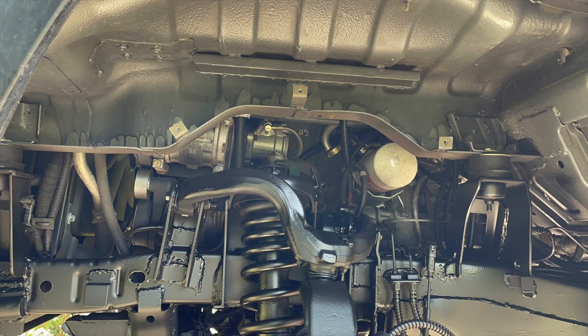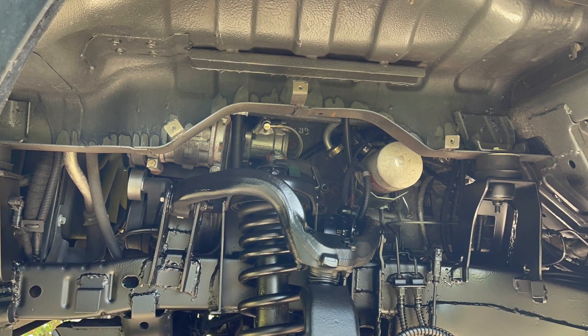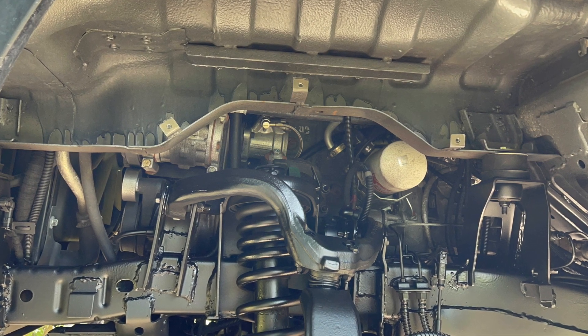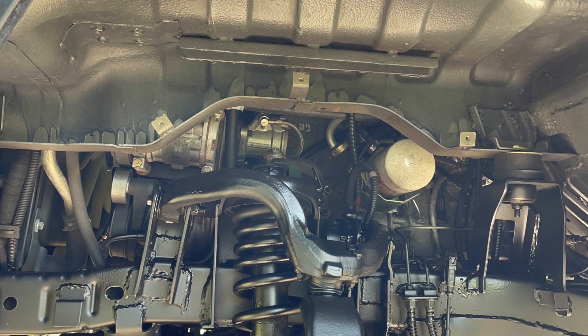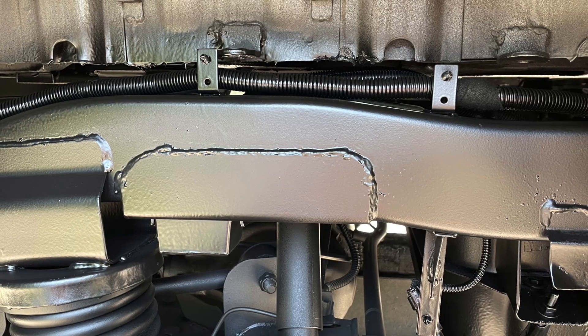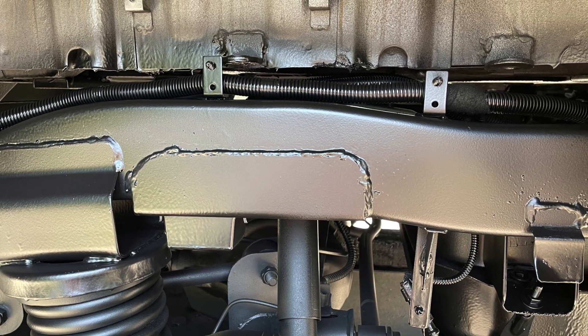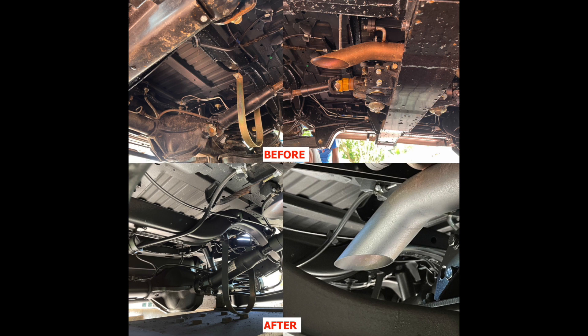The next job was to coat the underbody of the vehicle. We used a 3M underseal which offers good rust protection. After a thorough wash and drying, the vehicle was degreased and the coating was applied everywhere on the underbody. We used hammer tone paint for protecting the wheel well against abrasive materials being flung from the wheels. We also coated the exhaust with HD high temperature paint. You can see the difference before and after on the screen — it may need regular touching up but it offers a good first line of defense against rapid rusting.